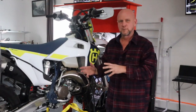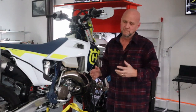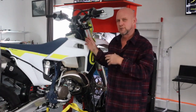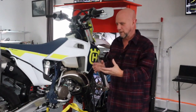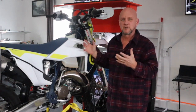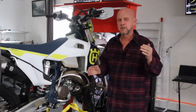It's also hard to pick up RPM off the injector pulse because you have two different injectors and they do skip around. So I use what's called calculated RPM — I hook up an RPM gauge to the bike that doesn't feed the information directly to the dyno, and I run the bike in fourth or fifth gear. I know that at 50 miles an hour the bike is spinning around 6,000 RPM, then I calculate RPM using that feature on the dyno. Of course that's going to change though.